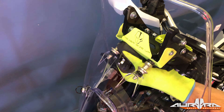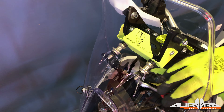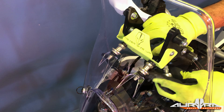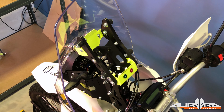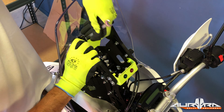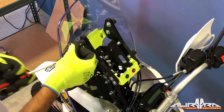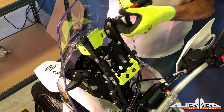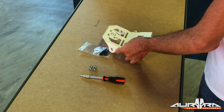There's no need to remove the rear side panels. You can install the stickers on the bike with the rear panels on. Just take care to match the shape of the original sticker. It will take a full day for the glue to achieve full adhesion, so it's better not to ride the bike until the next day. Check the alignment of the screen and tighten the aluminum pins at the top of the tower. Next, tighten all the M6 Allen bolts on the tower and torque them to 8 Nm.